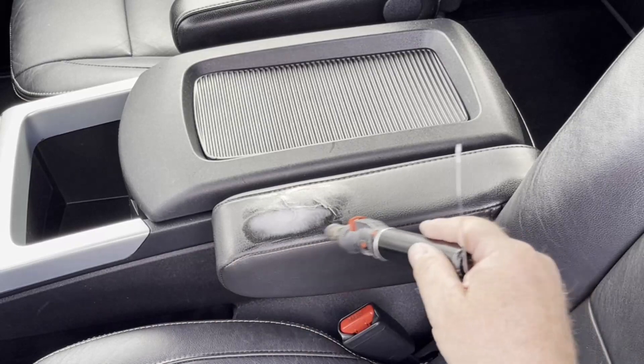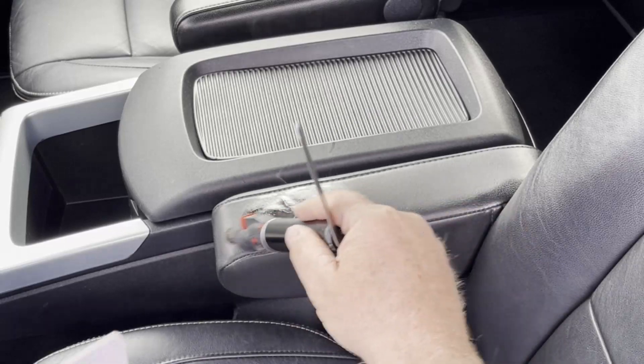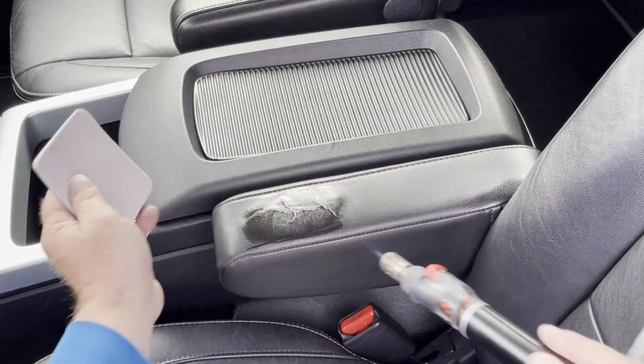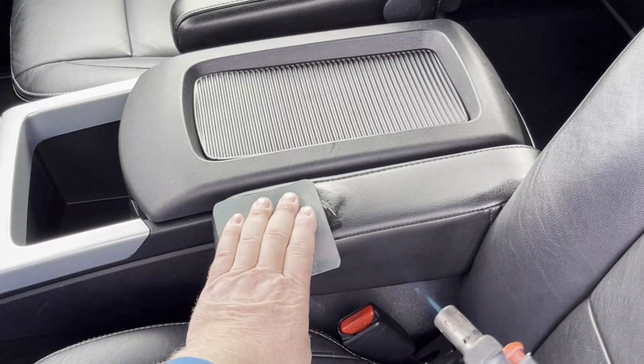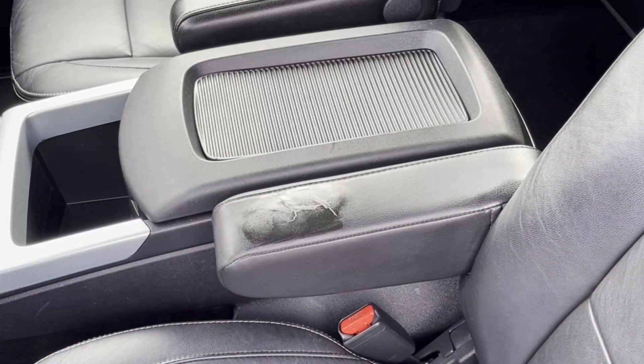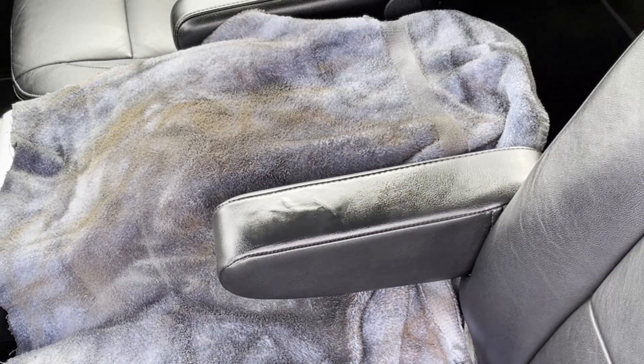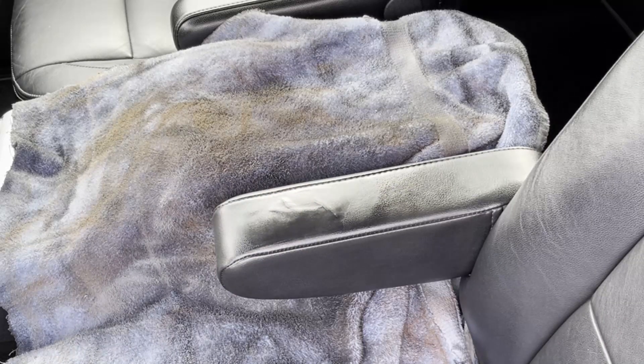It's just the driver's seat, after all. I'm just putting moderate pressure on here, nothing too crazy. I'm just going to set that grain pad down in there. Let's get some color on it and see what it looks like. You can see it's still a little rough — I can still see the cracks a little bit. We'll put another coat or two of product on there to try to smooth that out. Your graining texture spray from SEMS will also help blend that out.